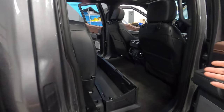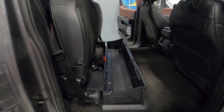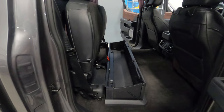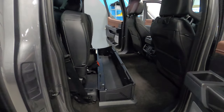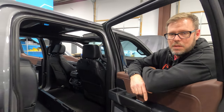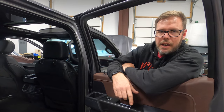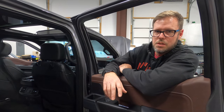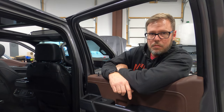So you guys can see back here, he has his factory tray — there's no subwoofer in here. We removed the full B&O Unleashed audio system. We actually left some of the factory speakers in place, like the ones in the headliner and in the headrest — we don't use those in our upgrades because they're kind of pointless. So this is a fully active two-way front stage, which means there's an amplifier channel for each speaker in the car. This is actually a seven-channel fully active system.